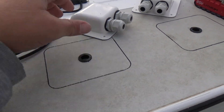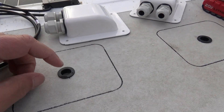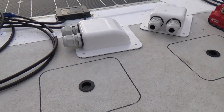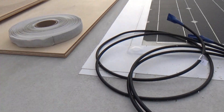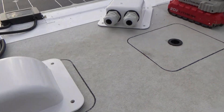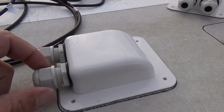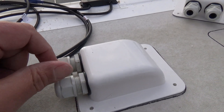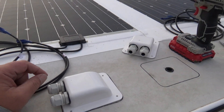I marked out where my covers are going to be. I drilled my holes and used a grommet on the inside and outside. Now I'm going to get ready to install the covers. I've got my putty tape that I'll be using. I'll drill four pilot holes, put putty underneath, and fasten those down. I'll run my cables through first just to make sure I can get them in there, and then we'll be ready to start on the inside.